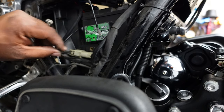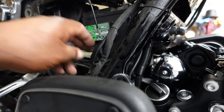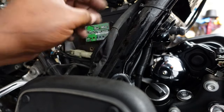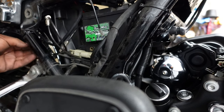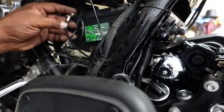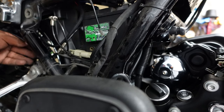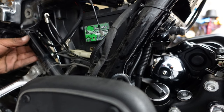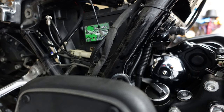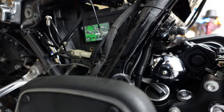And then we have the stem here of the splitter. It's going to go into the dump valve, which is going to be mounted over here on the firewall. So boom, boom, boom. And then basically I like to put the piping, like I said, over in this area. That way you can pull the side cover if you need to work on anything. I've been running air ride for several years now and haven't had any issues. So basically zip tie, make sure your airlines are out the way, clean everything up.